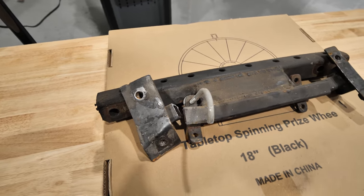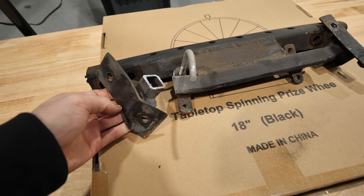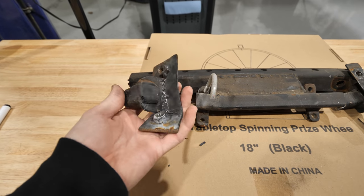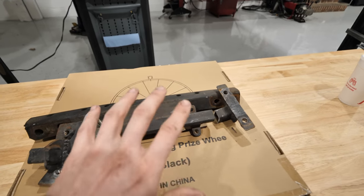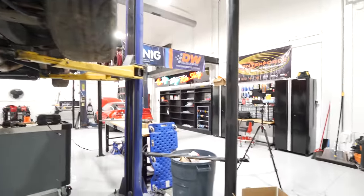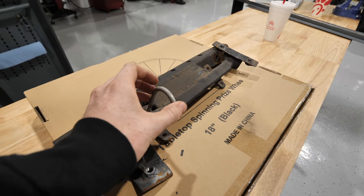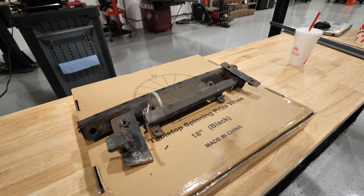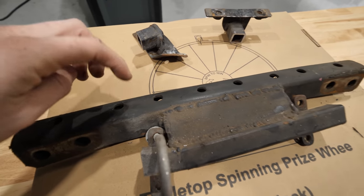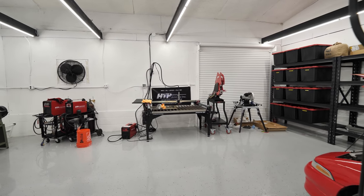You can see exactly where it hit. I had to cut it apart to remove it from the truck, and this used to be straight — this corner took the direct impact of the manhole cover. I'm pretty impressed it held together because this was literally the first thing I ever fabricated on any vehicle. I'm going to build a very similar mount, just a little bit stronger. It'll clamp the steering rack better because we had some death wobble issues from the mount not being tight enough. First step is to cut everything I welded off the stock subframe — and we're going to be using the plasma table today with some thick metal.